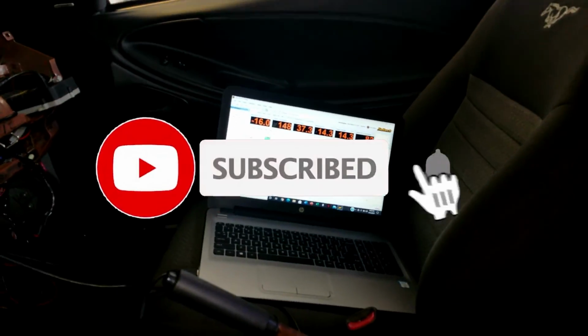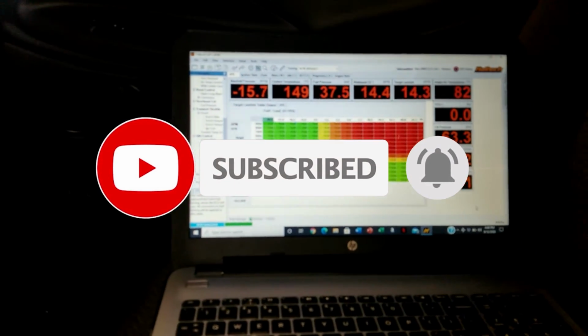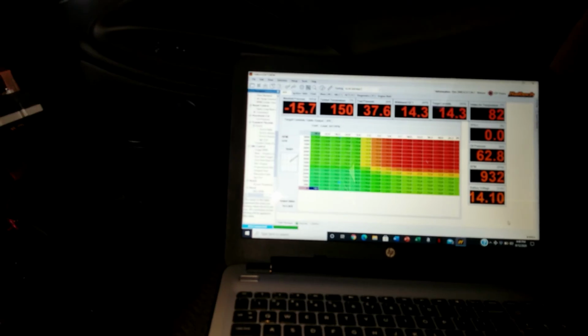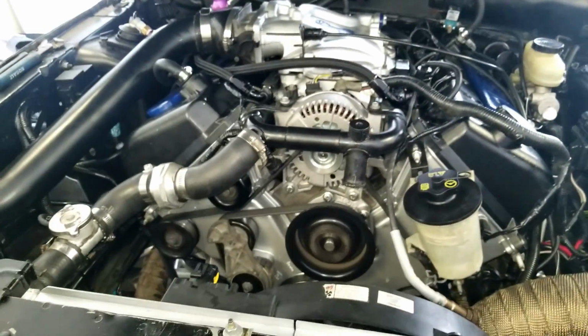Oil pressure's looking real good. Everything's looking spot on. So I'm really happy. Like I said, we're gonna flush it a few times. So we're gonna run this, and then I'm gonna flush it after like 2 or 3 heat cycles, and then put more oil in it, and we're gonna flush it again. So let me just let this run, and we're gonna throw the new one on here in a minute.